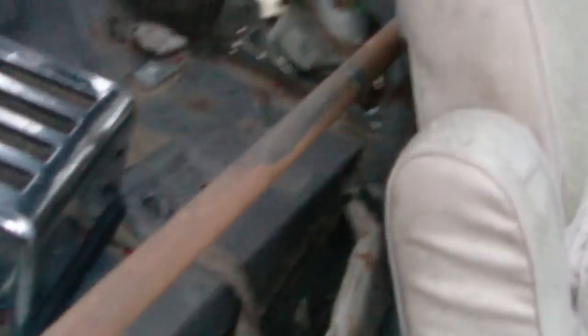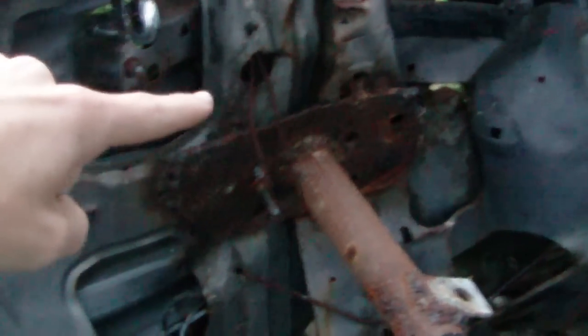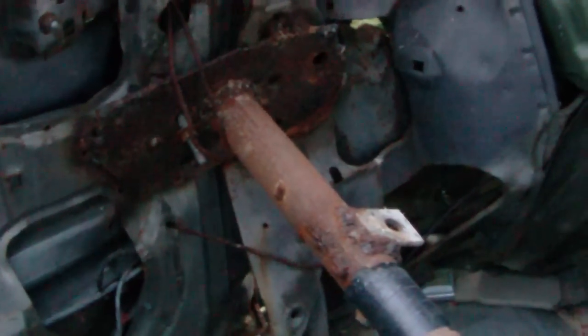The entire brake pedal and everything has already been removed — I took that when I took the master cylinder of the brakes. Something I recommend keeping out of cars is definitely the seat bar. This will be coming out of this car. There's even a leg mount on that side welded to the floor because the doors were bent so bad I put one in for the last run. The easiest way to remove seat bars — you don't even have to cut the seat bar. I'm probably just going to cut part of the metal from the door and pull the whole seat bar out with part of the inner metal of the car still attached to it. Then with it outside of the car I can clean it up, grind the edges, and turn it back into a normal bracket for the seat bar. That will work out just fine.